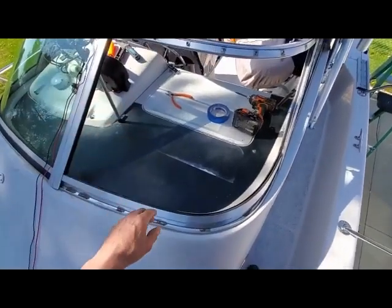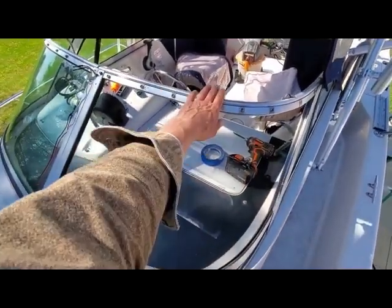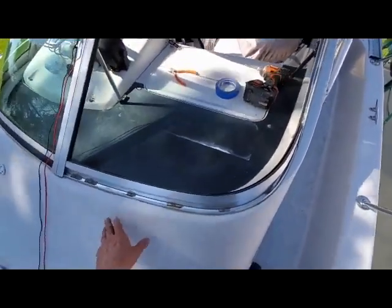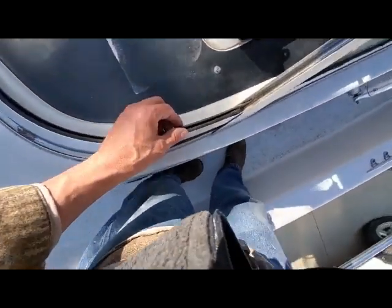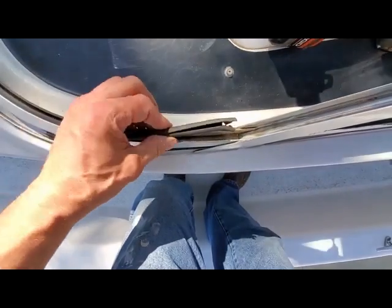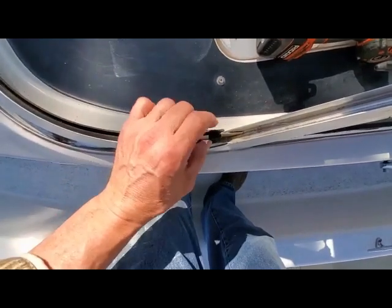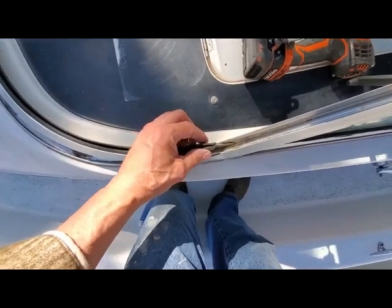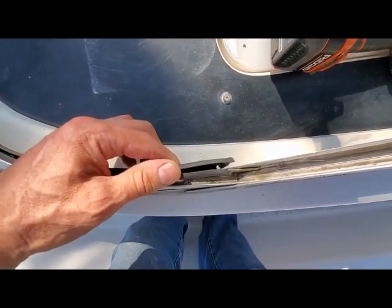Okay, so the glass is out completely from the frame. All the glass is cleaned out. I went ahead and put this back because I'm probably going to tape this up. Got rain coming the next day or two. But just the other thing too that I noticed, this boat is 20 years old, and this gasket that pinches the glass together as it seats into the track, it's pretty hardened, and just trying to get it out, obviously you can see that it got a little bit roughed up because it was so brittle.